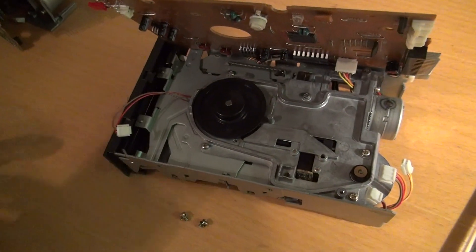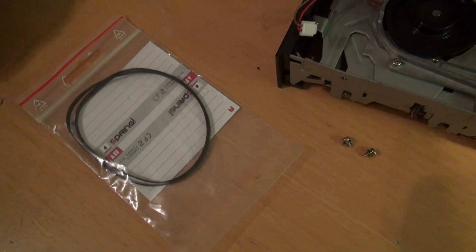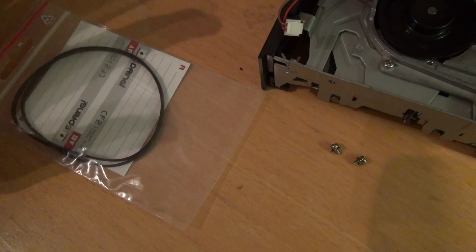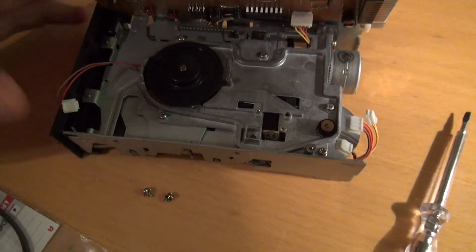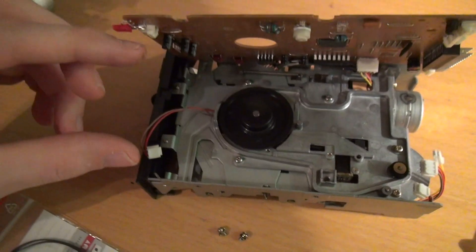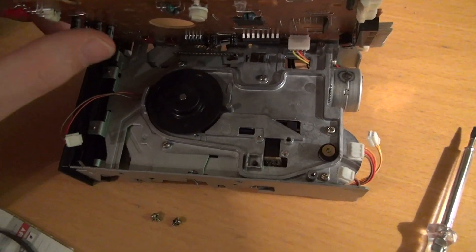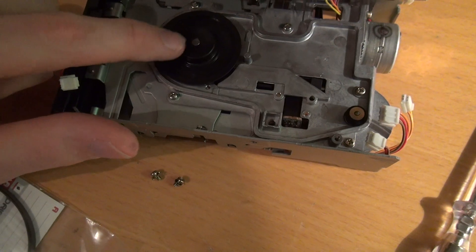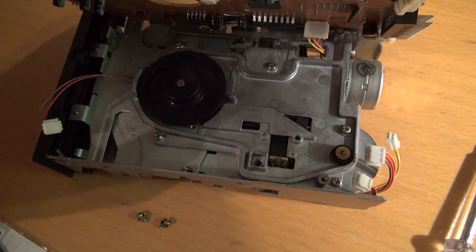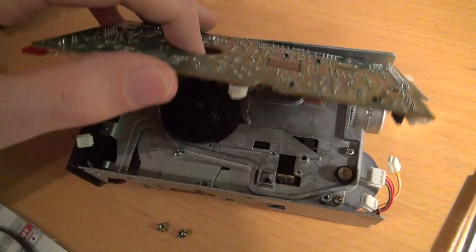What has to be done here is pretty simple. I've got two new belts here — I hope they fit well. They are sold especially for this floppy drive from a video game seller that sells this stuff. Now, I had to disconnect the motor connector right here and the three other connectors there. What you first do is pull the PCB slightly back, and of course this motor thing that sticks out will be in the way, but you can easily manage by pushing it around a little bit.